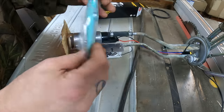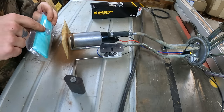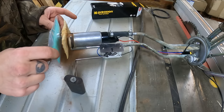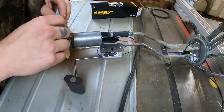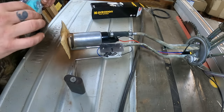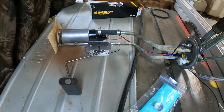There's two different kinds of fuel socks or fuel strainers. One was centered, and then the other one had a port that was pretty far off to the side. So I got the one that looked most similar, but I don't know, maybe I got the wrong one. Actually, no, it kind of looks like that slips over that. That doesn't make things easy, though. I have to snip those off and get some hose clamps.